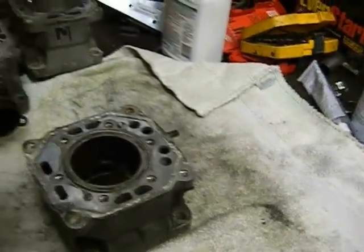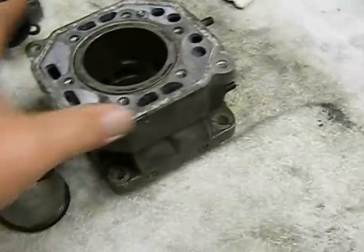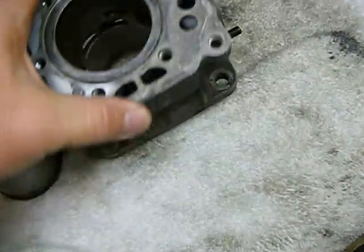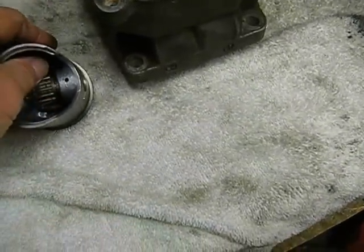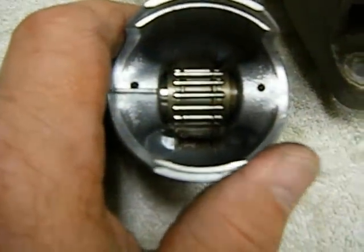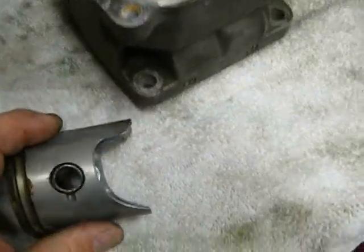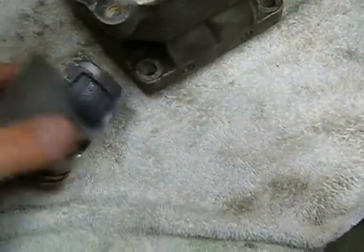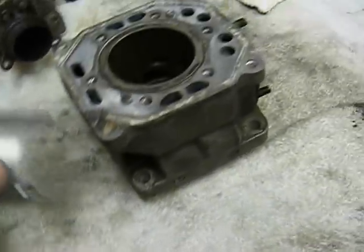This is another eBay piston, about $100, came with a pin and a nice bearing. If you buy an eBay part, you want to look at the piston pin. If they're not showing you a lot of pictures, be aware — a scratch or crack in the cylinder is no good, and there's a reason why they're used parts and why they're cheap. Look at the pin and the bearing. What you don't want is for the bearing to be blue — do not buy a blue pin or blue bearing because that got hot and it's no longer any good. Also, I recommend you buy new circlips, or inspect the ones you have very carefully, because if one comes out, you've launched your engine.